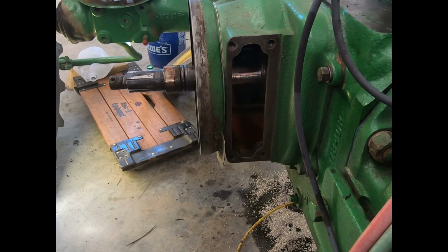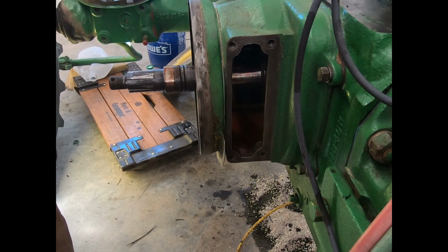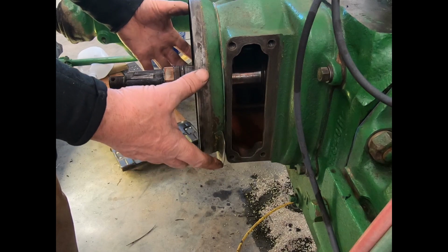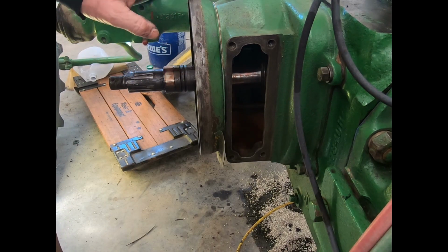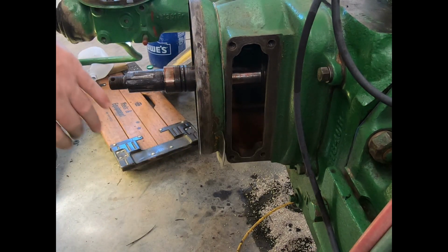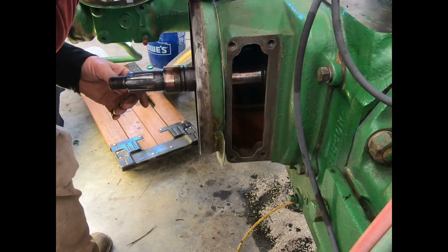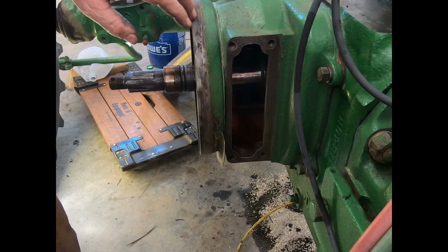Boy, there's not much on the inside of that pulley. It's only hitting on this front. That sucks. Anyway, when I put this on, there's always slop in the bolts, and I kind of tried to pick it up, put it midway, and I should have just left it sitting on the bolts. Although it shows signs of rubbing all the way around from before. Yeah, I've got rub marks all the way, so I don't know here. I've got to do some cleaning. I'll be back.